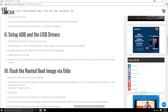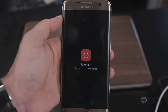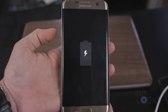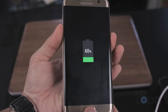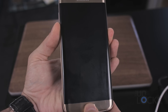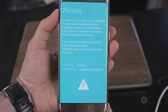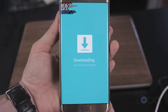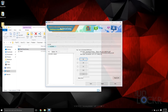At this point, we can plug the phone in via USB. Then we're gonna turn the phone off, and turn it back on by holding down Volume Down, Power, and Home all at the same time. It'll eventually give you a screen — push Volume Up to continue and it should be in download mode. Then right-click Odin and run as administrator, and it should open up.